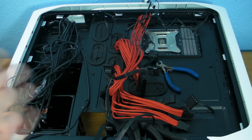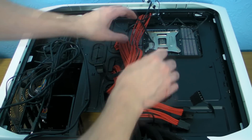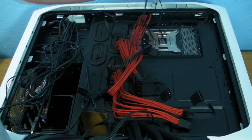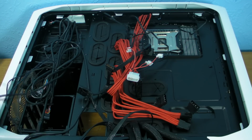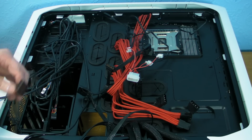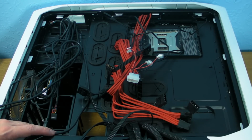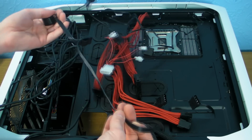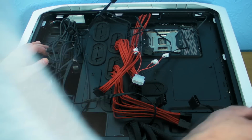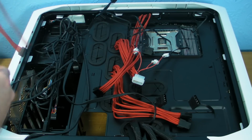Right then peeps, we're just having a gander round at what we're going to do. I know that I've got 1, 2, there's one here, 3, 4 Molexes that I'm going to need for this side of the case. And then there's also another one at the front here to power the fan controller, and I also know I'm going to need one for the SATA power extension on that side. So I'm probably going to have to put another Molex cable in, but I'm going to see if I can get away with not using the SATA cable instead to keep it tidy. Because if I don't have to use a SATA cable, I can basically swap one with another.